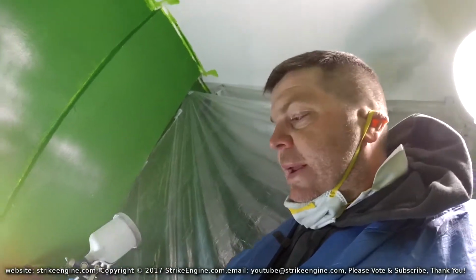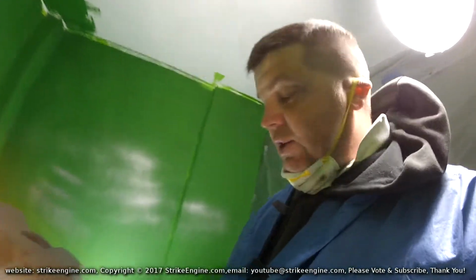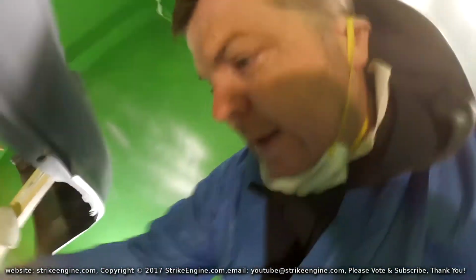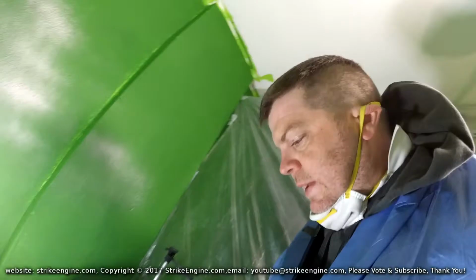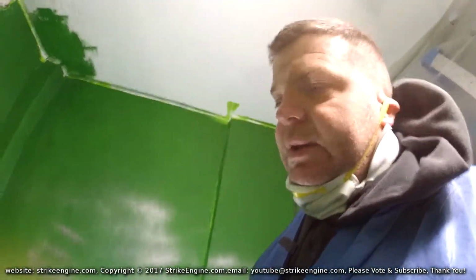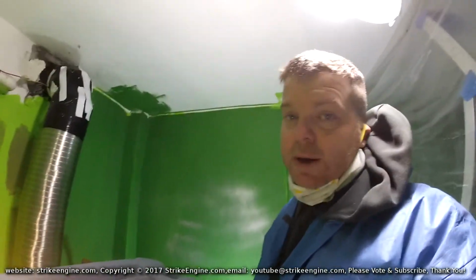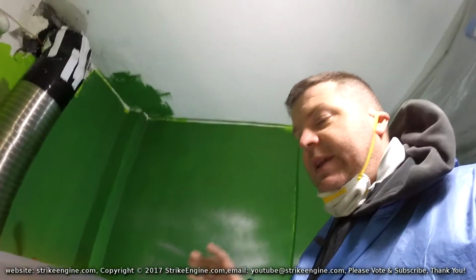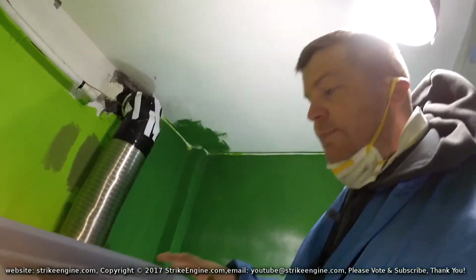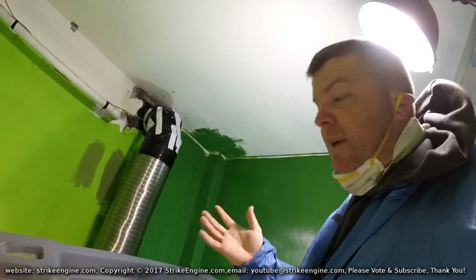So I've got the paint made up. Just go to a place that does automotive body supplies, and they've mixed me up a litre of paint, which is here. It's much cheaper than going for cans. Don't get me wrong, I've got nothing against spray painting with a can. I think you can get a factory finish with a spray can. The only thing is, you have to have strong hands, because you'll be pushing the button for a long time. And second of all, they can get expensive. For this bumper, I would anticipate I'd probably go through 4 cans of spray paint, maybe 5.